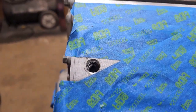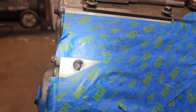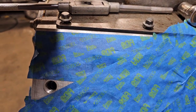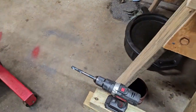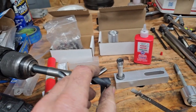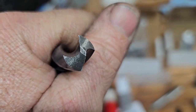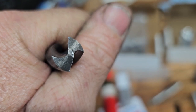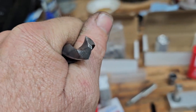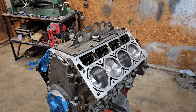As you can see, I've already drilled one - it's already got the insert in it. It was a piece of cake, all went well, no issues at all. I learned a few things doing the first one. He also sends the drill bit you need, and this one cuts really nicely - didn't grab or cause problems with the aluminum. He even ground the tip off so that when you get to the bottom of the hole it'll basically just quit drilling so you won't accidentally keep going and damage your block. I thought that was a nice touch.